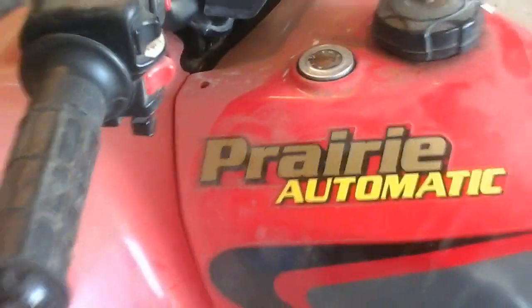This one right here. And that will release the front fenders, and then all you'd have to do is just pop that out from the gas tank covering. Another thing that I just now realized is that the mud guards are all connected by the same Phillips head screws, 3 on each side. You want to remove those.